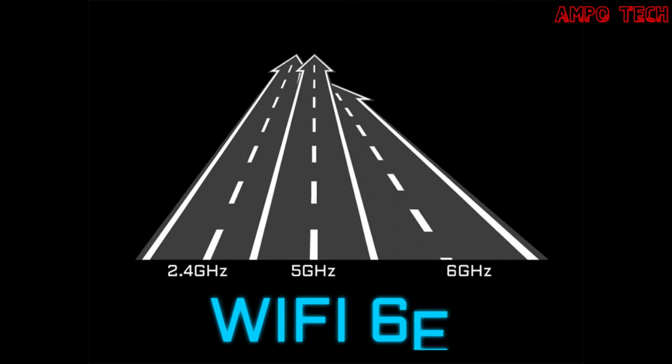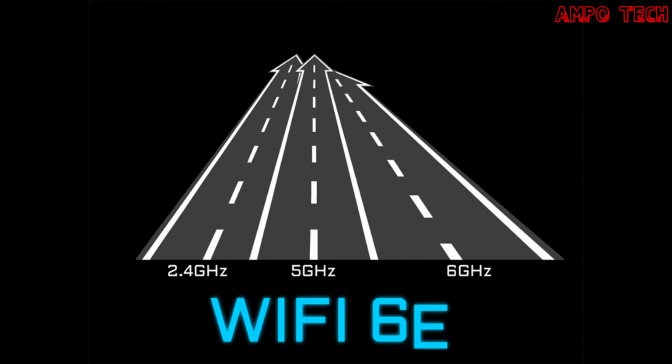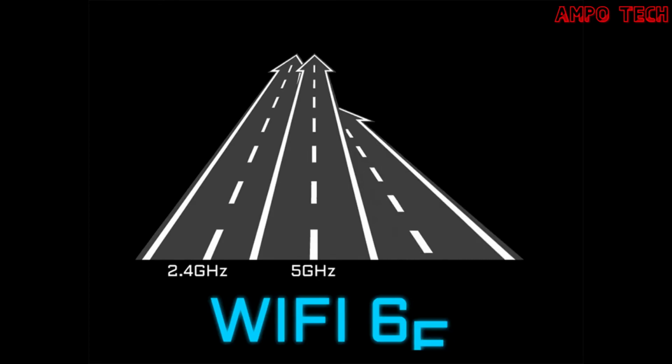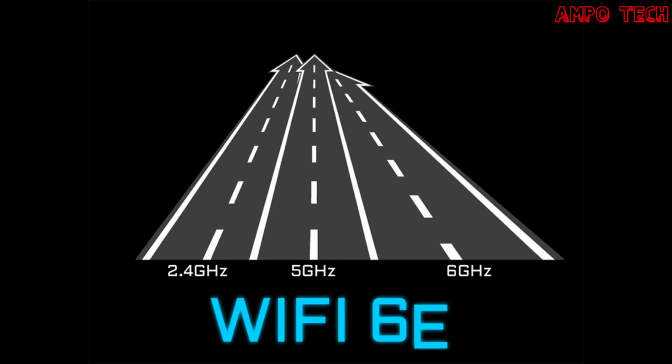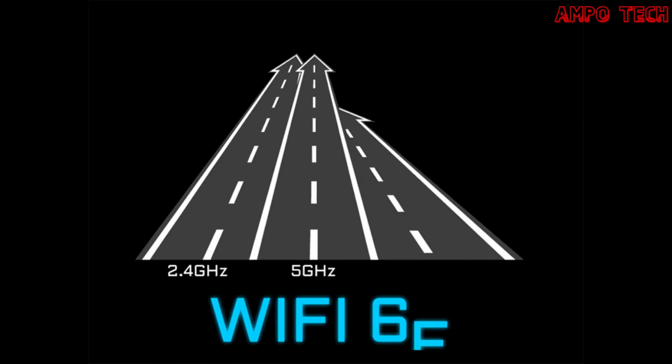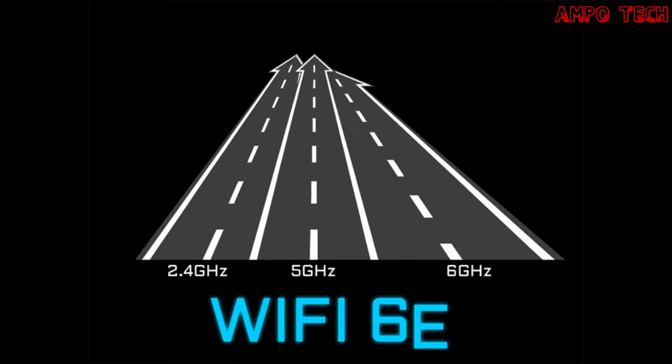The Wi-Fi 6E, which features Realtek MIMO technology, means the latest Wi-Fi 6E solution supports the 6GHz spectrum, Bluetooth 5.2, two-way MIMO and BSS color technology, providing up to 4 times network capacity and efficiency in high signal density environments, delivering speeds up to 2400 megabits per second.